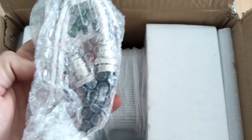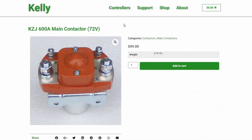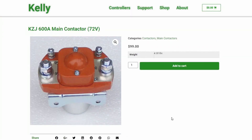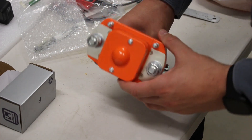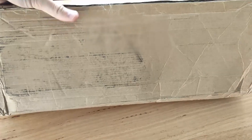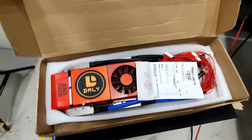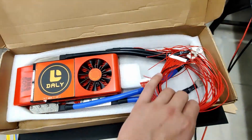There are heaps of exciting features in this controller that we'll explore in upcoming parts. Another key component is a high-powered contactor used to safely connect and disconnect the battery from the controller — I got the 72 volt 600 amp contactor from Kelly as well, which is a lot bigger than the Cole Hersey solenoid from the previous setup. And this time, having learned my lesson, I've bought a Daly 500 amp 24S BMS, which balances cell voltages during charging and monitors and protects the battery during discharge.